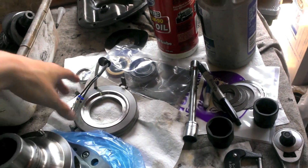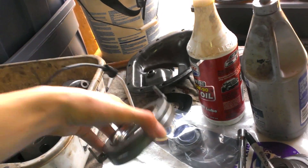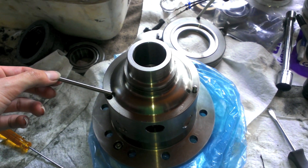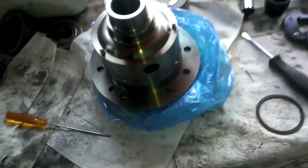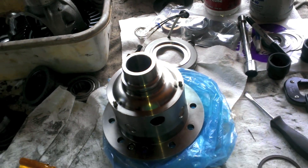There you go. This whole assembly comes off — it's a two piece thing. Here's your three pinions. These are what activate and lock your locker somehow. So now you can get your ring gear on. Pop your ring gear on, then you can put that back on, then you can put your bearings on.